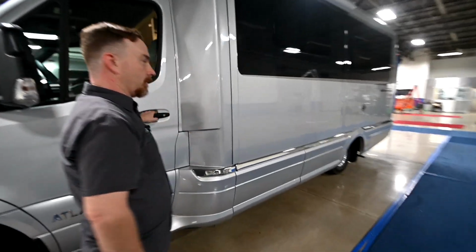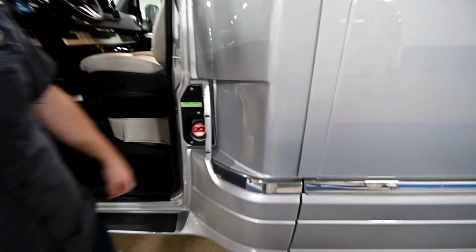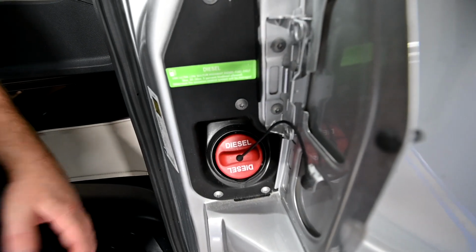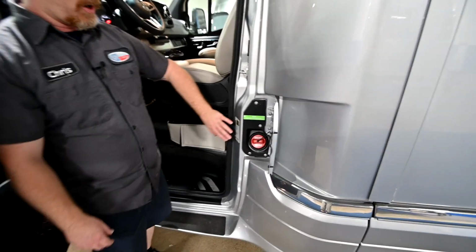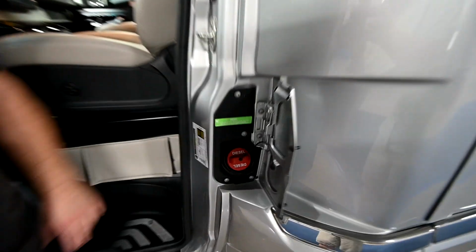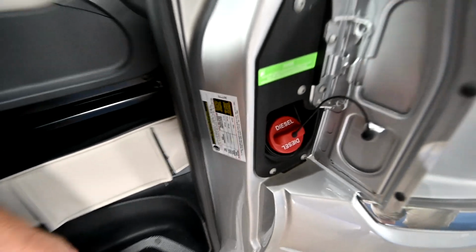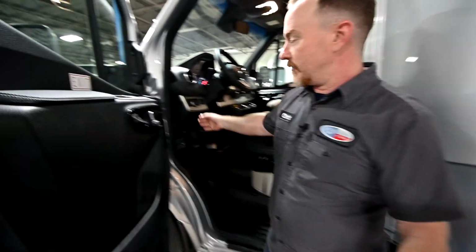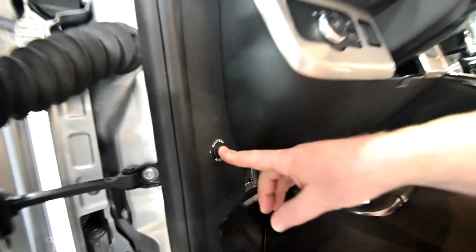Now, the engine battery is underneath the driver footwell, but it is difficult to access. You have to pull a couple of panels free, which is why they have provided this external point here. We've got your washer fluid container here, and then these are manual air valves to fill the rear air suspension. In case the onboard air compressor has stopped functioning and you needed to get it up on a flat bed to have it serviced, you can add an airline to that and inflate the rear airbags on your own.